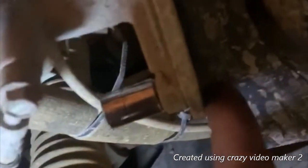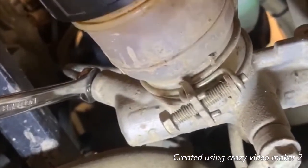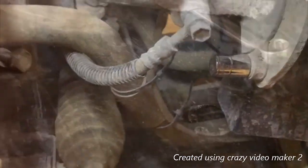It feels like these nuts are welded — and you can see the weld there actually. They're welded, so you should just have to be able to get a ratchet or whatever your choice of tool is in there to take them loose. I'm also going to assume when I take this loose, all this brake fluid will drain out. The brake fluid looks kind of clean, but whatever — you never know. So I'll do that and then we'll get on the bench and see what we get.